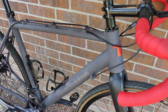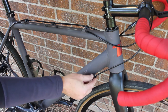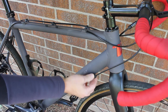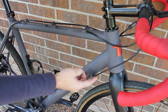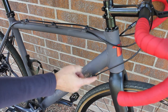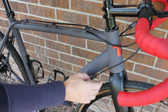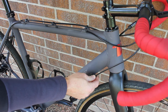The last hurdle I had to overcome was tensioning on the front derailleur cable. Van Dessel used a 6mm hole here for the cable adjuster, but like 95% of frame cable adjusters are 5mm. So I kind of hacked this together from a mountain bike brake cable adjuster and a piece from an old derailleur. This is not actually being used for tension — I'm only using it to hold the end of the cable, and I'm using an inline cable tensioner to actually put tension on the front derailleur. Something to keep an eye out for if you get one of these frames is to try and find a solution for this front derailleur tensioning.